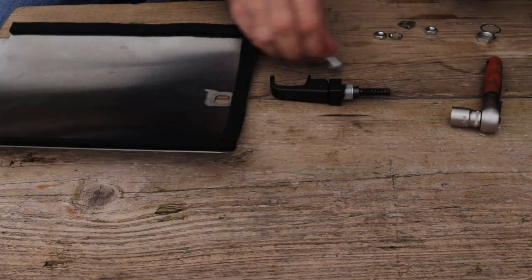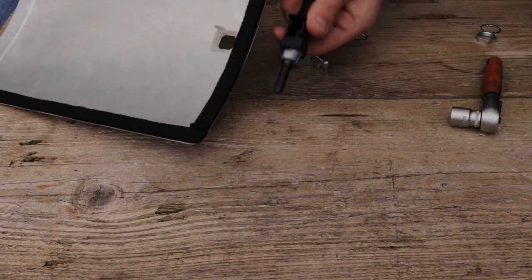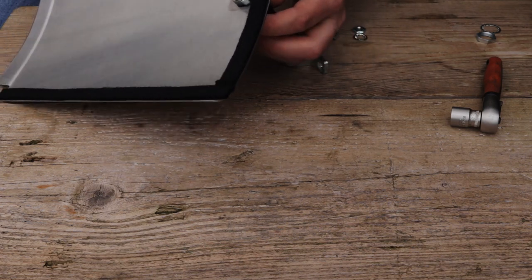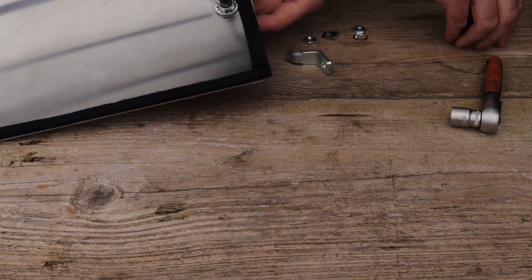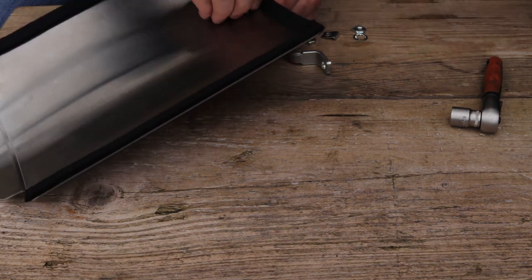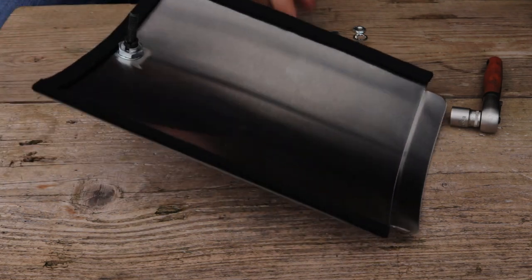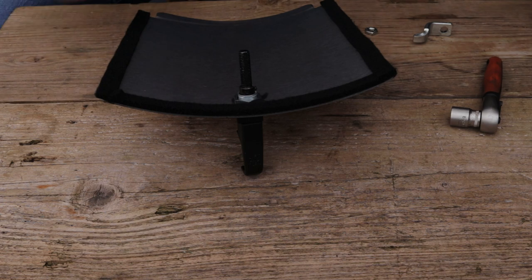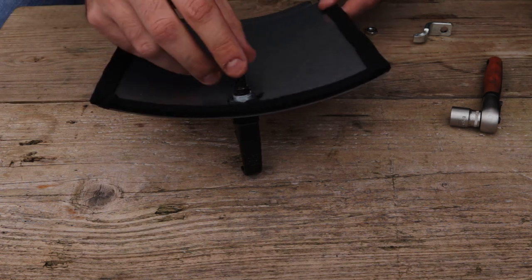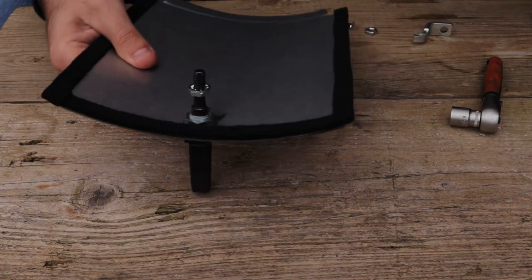The handle has a few parts to it. The first thing we're going to do is mount it to the door — this is a square nut so the handle fits through quite snugly. Put on the lock washer and the nut. Finger tight is probably tight enough on these; if it starts to loosen off I'll go back and tighten it with a spanner. Then this is the part which will hold the actual door latch — we need to mount this to the drum to get it set properly. I'll start by putting on the first nut and the little lock washer, and then we'll get the door onto the WSM and get it tightened.